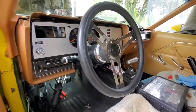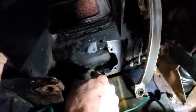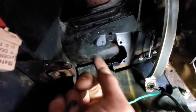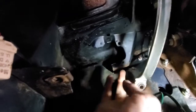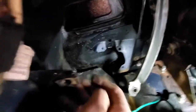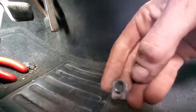On the driver's side, if you look in underneath the dash, there is the light switch. If you look up even further, there are going to be three bolts — one, two, three. Those three bolts are what you'll be bolting your motor up into. You want the arm that you just attached to your new motor facing you. That arm is attached to the little arm that sticks out, and on top of that you will want to put this bracket.